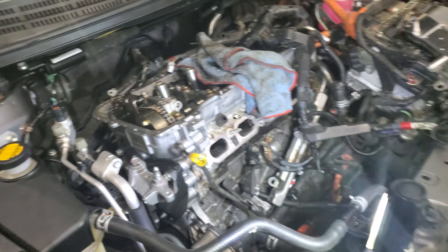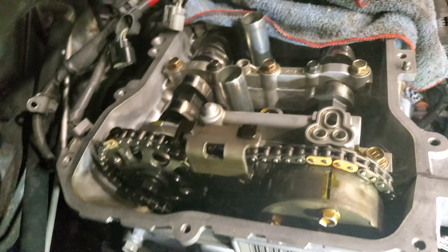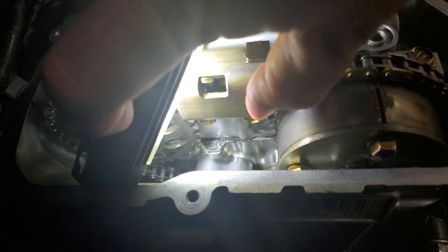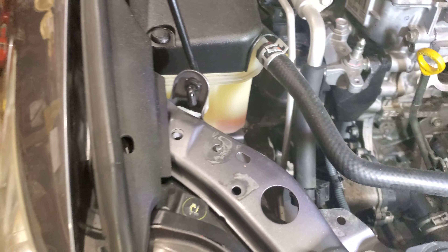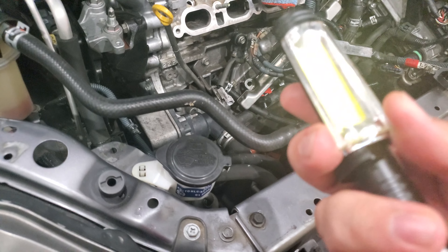I'm going to put it all together and see how it runs. If I still see something fishy, then I'll do a head gasket job — I have a head gasket kit ready. But I think someone already did the head gasket job on this vehicle because there's a mark here that doesn't look factory. Right under my finger there's some sputter from the gasket material. I don't think that's factory, so someone was in this area before. I want to be sure it actually needs a head gasket before I do one.